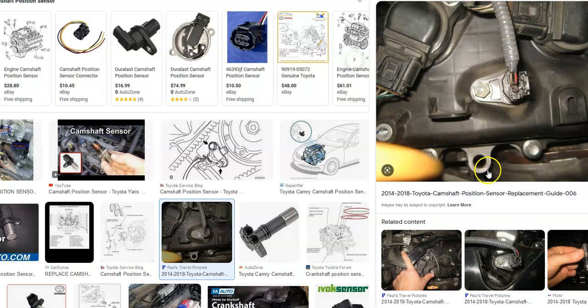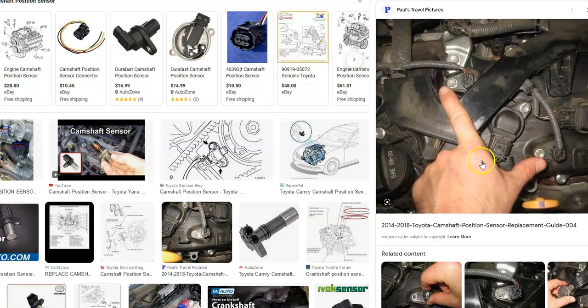While Toyotas can have one sensor, with this code there are very likely going to be two sensors, so you need to Google which one is sensor A. Many people go ahead and swap out both sensors, but this code is pointing to sensor A, so that's the one that needs to be swapped out. That's basically it — a quick overview of how to fix a Toyota with the P0348 code. If you have anything to add, comment below. If this video helps you, please click like, subscribe, and have a good day.